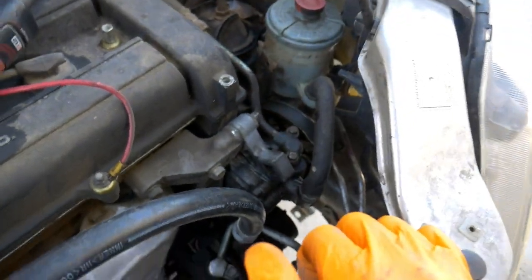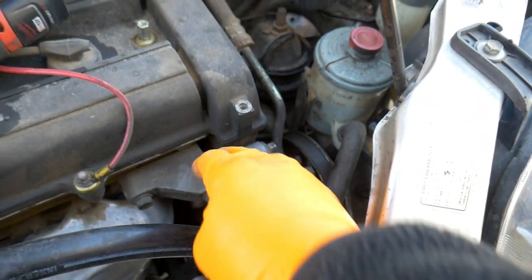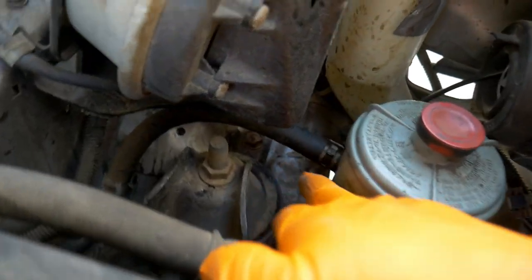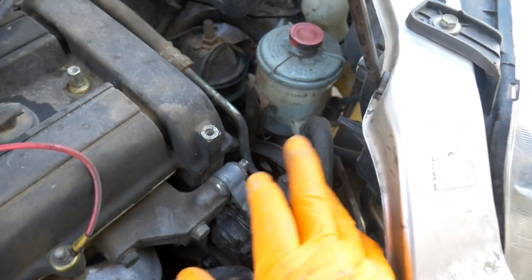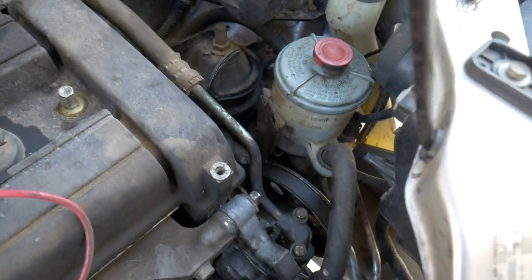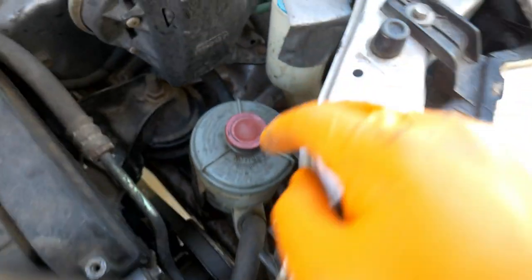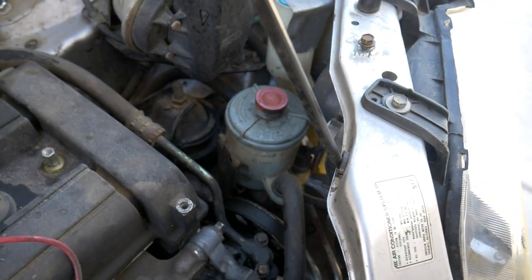What I'm going to work on next is getting all the power steering components removed — two 12mm bolts on this one and that one underneath to get the power steering pump off the brackets. I'm going to disconnect the two 10mm lines here and then disconnect this line from the power steering reservoir so I can pull off the reservoir with the line and the pump itself. It might be kind of messy, so be prepared with some rags and have power steering fluid ready to refill. I need to get to those lines and there's nothing I can do about getting the two bolts off the top of the receiver dryer unless this is removed completely.